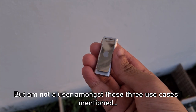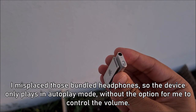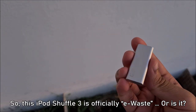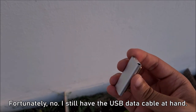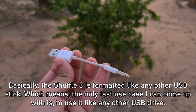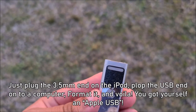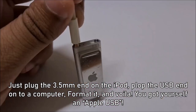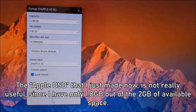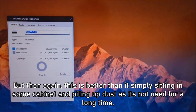I'm not among those three use cases though — I misplaced the bundle headphones, so the device only plays in auto-play mode with no option to control the volume. That's quite useless, more like a music loop app programmed in Scratch or Python. So this iPod Shuffle 3 is officially e-waste. Or is it? Fortunately no — I still have the USB data cable, and all iPod Shuffles are formatted with the FAT32 file system. Basically, this Shuffle 3 is formatted like any other USB stick, which means I can use it as a USB drive. Just plug the 3.5mm end into the iPod, plug the USB end into a computer, format it, and voilà — you've got yourself an Apple USB. It only gives me 1.8GB out of 2GB of available space, but it's better than sitting in a cabinet collecting dust.